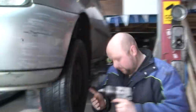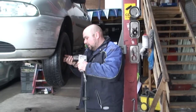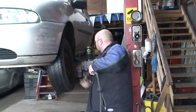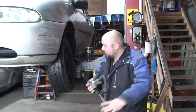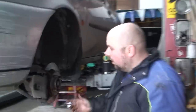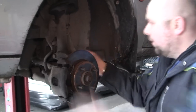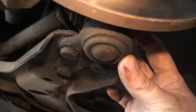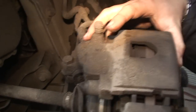Whip off the old wheel. Now this is what you're left with. The wheel bearing is behind your disc. So what you need to take off is your track rod end, your lower ball joint, your suspension bolt - that disconnects this. Then take off your caliper and carrier, because what we need is to be left with just the hub, just this part here.